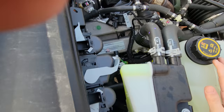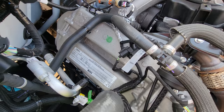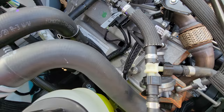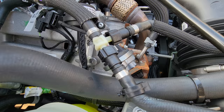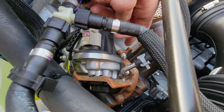Let's look at the passenger side valve cover. Climbing up on the medium duty truck gives a better view. Here's the EGR cooler — you can see how far back it stretches onto the passenger valve cover. It can be cumbersome to remove at times. On the front of it is our EGR valve. If you can differentiate the metals: this is the cooler, this aluminum piece is the EGR cooler bypass, and then the EGR valve bolts to the front of the bypass. For those remembering the dreaded 6.0 EGR valve problems — we don't have those kinds of problems on these trucks.